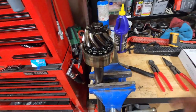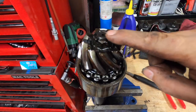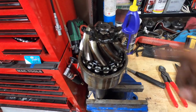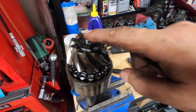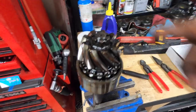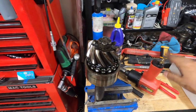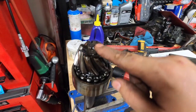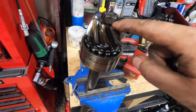Now I've got it just clamped in place. Next we're going to be removing this nut — it does have a cotter pin in it. When you reinstall this, make sure the cotter pin is not bent over the top; you want them bent down around the side. Otherwise if you install it the wrong way it will interfere and you'll have issues. With just a little convincing, the nut is backed off just past the end of the threads, leaving a little gap between it and the gear.